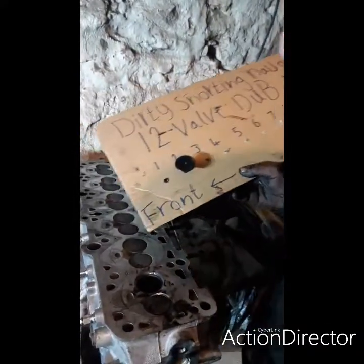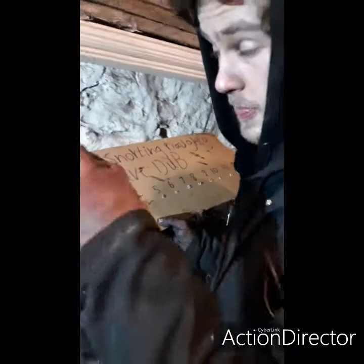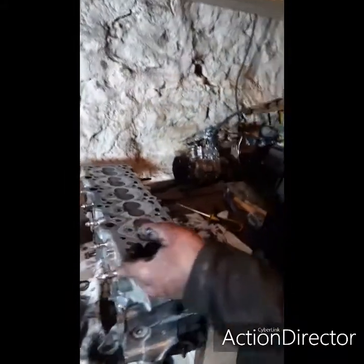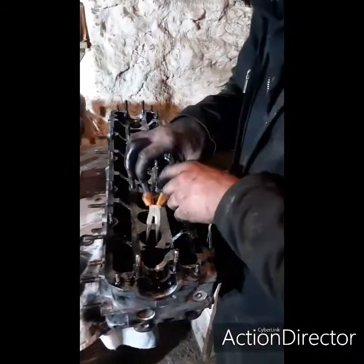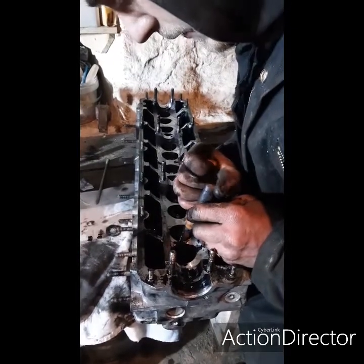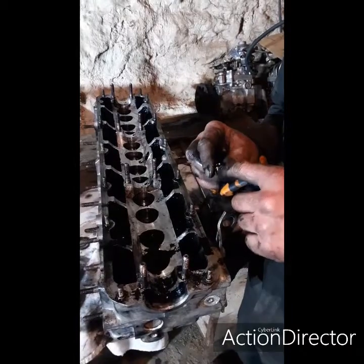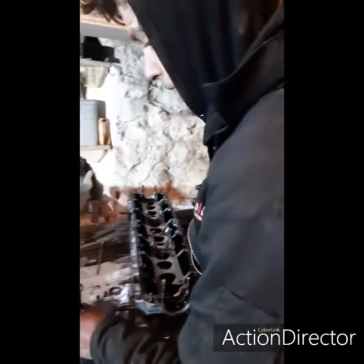So that's number 2, by the way. This is number 1, and keep them in order, because the actual valve guides, shall I say, can wear slightly differently. So basically it's just keeping them in a better position, unless you was replacing all the valve guides, but we're not going that far. So yeah, pop that over there, and then flip it back over, and we want to do a bit of wiggling about and try and get the stem seal off, which hasn't proven too easy with the first one, but that one didn't go too bad. So yeah, they're basically worn, and I'm thinking that's why it was very smoky on startup, because it's burning a bit of the oil, and then obviously when it gets hot it's not as smoky, because it'll burn the oil better basically. But that's number 2.